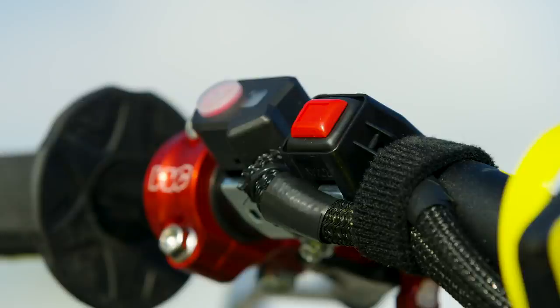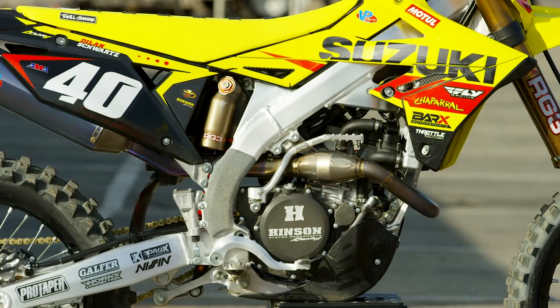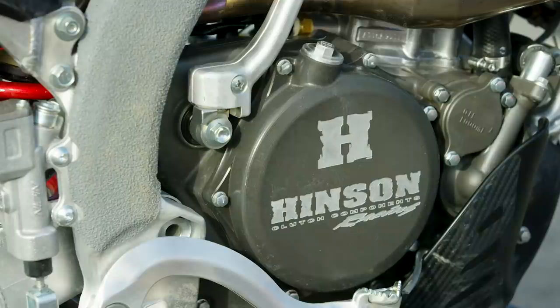The Suzuki and the Yamaha are the only two 250s left in the class using a cam-over-bucket design, meaning the camshaft lobes contact a bucket which presses down on the keepers and valve shim, pushing down on the valve spring and opening the valve. Many expected all OEMs would change to a finger-follower design like KTM, Husqvarna, and GasGas, but as Star and even Bar X have proven, you can still make a lot of power out of a standard cam-over-bucket design. The bike is dual fuel injected stock, though we wouldn't be surprised if Jamie has tweaked the throttle bodies — tapering them and changing overall size — and played with different injectors for different spray patterns to get the best out of this machine.